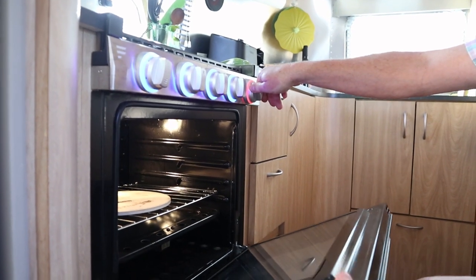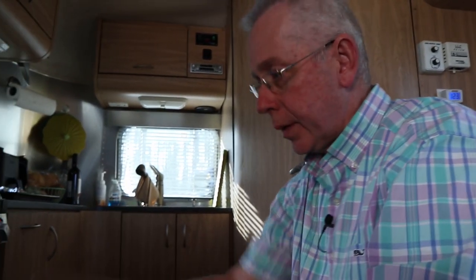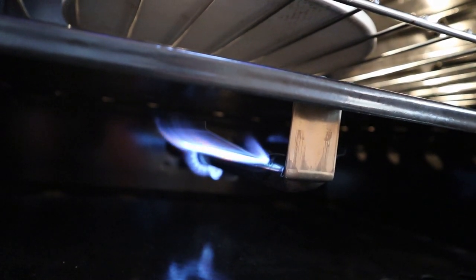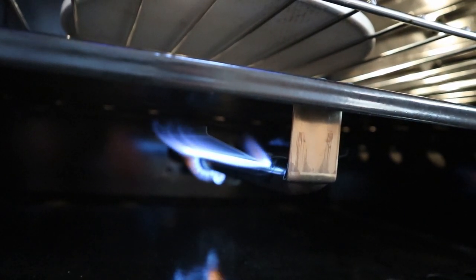Now we get to wait a few minutes for the thermocouple to heat. The pilot light is lit. We held it for about three minutes, then slowly moved it out — if you move it out too quick, the pilot light goes out. Now we're going to try lighting the oven. There you have it — the process of lighting our oven. That took about ten minutes, which we consider a glorious success in the annals of this oven.